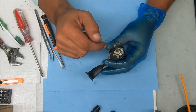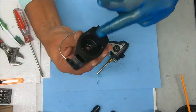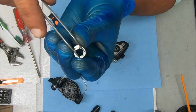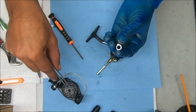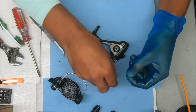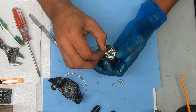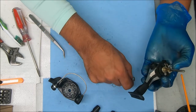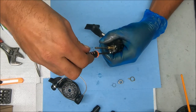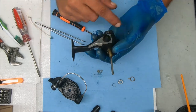Let's do the housing — the top part first. Take that off and you'll see the two slots: one wider, one shorter. They'll have to correspond and match up onto the rotor when you put this back together. This piece has a spring underneath — you can pull it off. Then you have this plastic piece that just comes up. I moved that dog out of the way to get to it. We can unscrew this — that's the dog for it — and there'll be a spring under there as well.